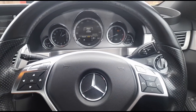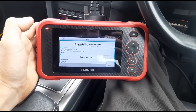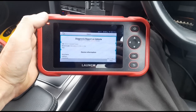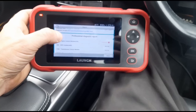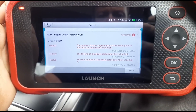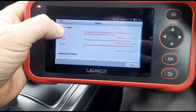I've got my Launch EuroTab 3 scan tool here, but what I'm going to try and do — a few people have asked me — is use one of the cheaper tools and see if I can do the full diagnosis and repair using one of these. A quick scan already done: number of regenerations in the particle filter is too high, fill level of the particle filter is too high, and the soot level is too high.